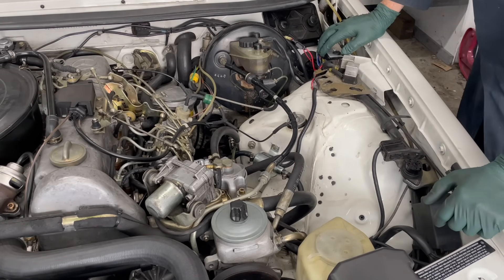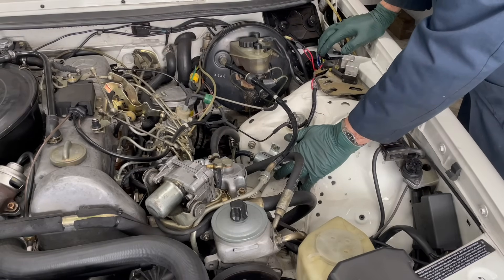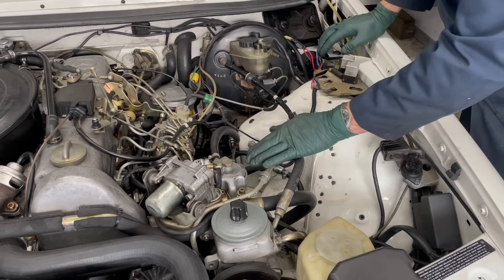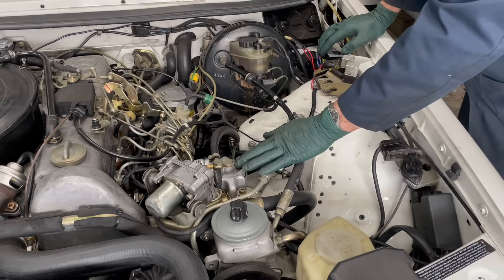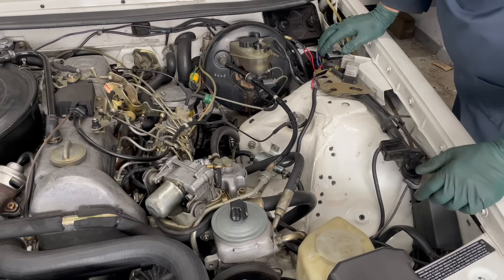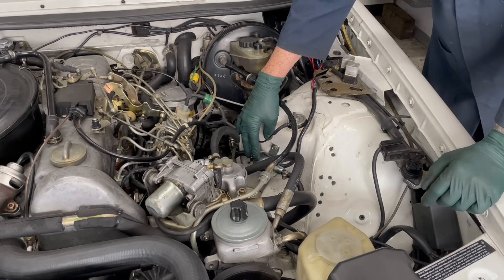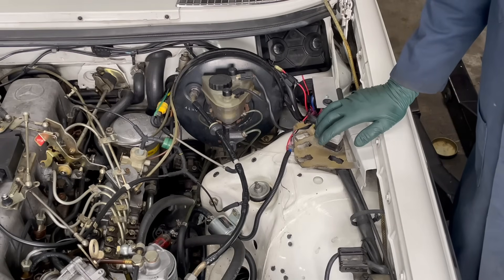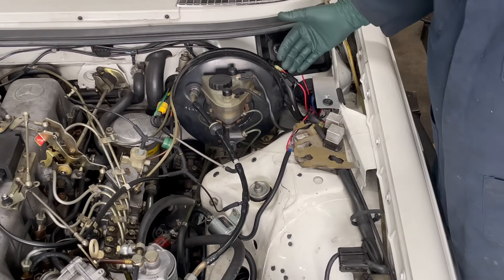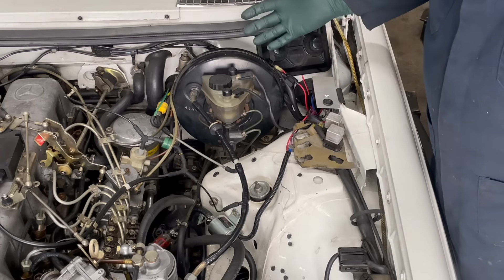You've got this five to six PSI pump adding boost to the lift pump, which in turn delivers a more steady fuel flow to the fuel injectors. There are also subtle benefits: if your fuel tank screen is partially plugged, this is going to help pull fuel from the tank. It's also going to help push fuel through aging fuel filters that aren't performing as well. For a number of reasons, I think you'll find this is an amazing upgrade for the price and ease of installation. That completes the installation for the fuel pump boost upgrade.